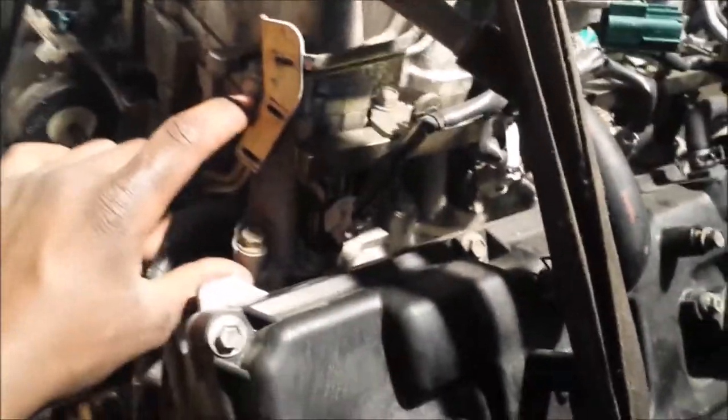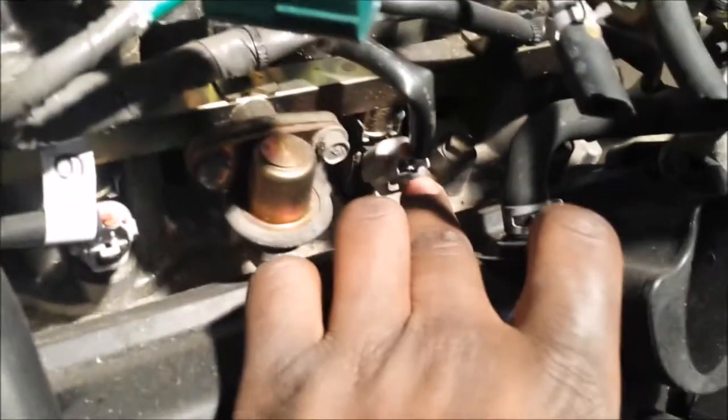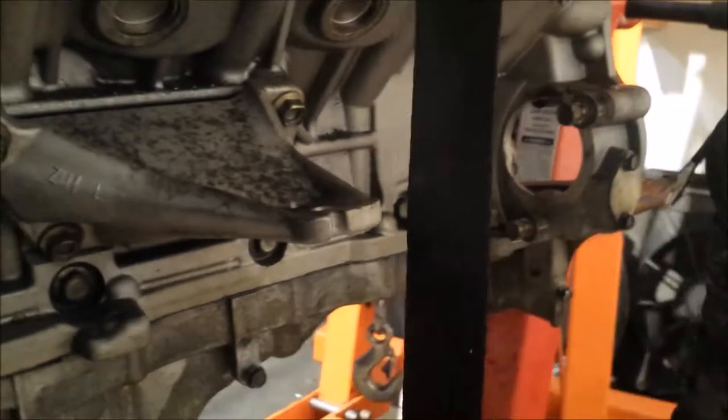The injectors are right here, affixed to the intake. This is the lower intake collector, and this right here is the fuel injector. They're port fuel injected rather than direct injection, where nozzles are within the cylinders. One difference: this JDM engine has the starter on the left/driver's side, which is how the 2006 is set up. The 2003 M45 has the starter on the opposite side — that's one big difference.